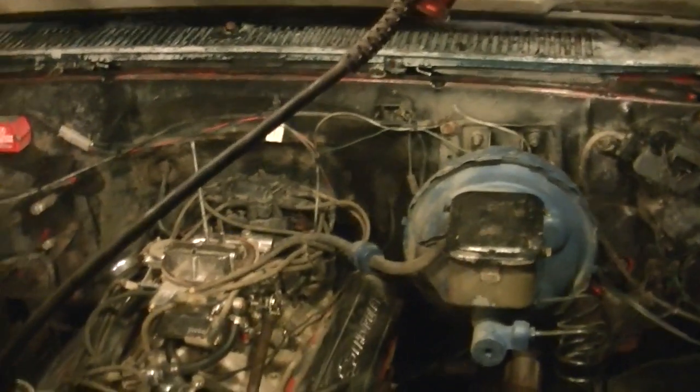The other header. Alrighty then. Well then, you're going to want to change the oil because you probably just got mud down your dipstick tube, and you're going to want to blow some air through that and change your oil. Run it for a minute, change the filter. Well, actually, I'd blow air down it, blow a little oil down the dipstick tube, blow some air down it, run it for a minute, and then change the oil and filter. But I didn't get but just a couple specks of dirt in there, but I know what's in there, so it's going to bug the shit out of me.